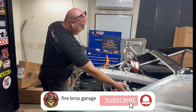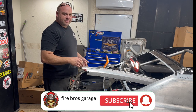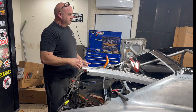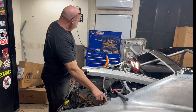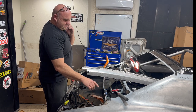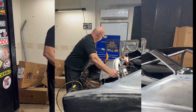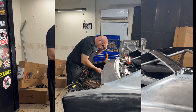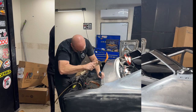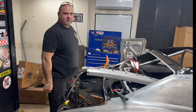I'm trying to get all this metal nice and flat and get this fitting right. As with any of these panels, there's going to be some massaging. This corner right here is not really fitting that great, so it's been in and out a few times already. I'm going to have to grind this corner off — it's just not sitting down all the way. Hopefully a few more ins and outs and this thing will be fitting so we can get it welded in and move to our next project.